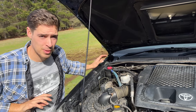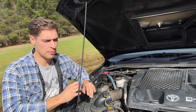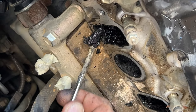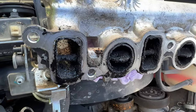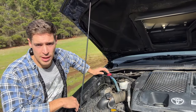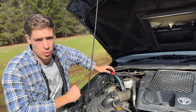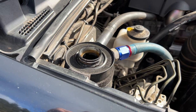Liking all things on a budget, I've made myself a catch can. Looks dodgy, but I don't want any more of that soot getting into my engine. You guys saw in my last video — I cleaned out the intake manifold and the EGR, and it was caked. It's absolutely filthy. So having this makeshift catch can will just help keep that oil out of the engine. It's basically an old paint stripper bottle, mounted to the side. This comes off and all the old crappy oil gets caught in there.